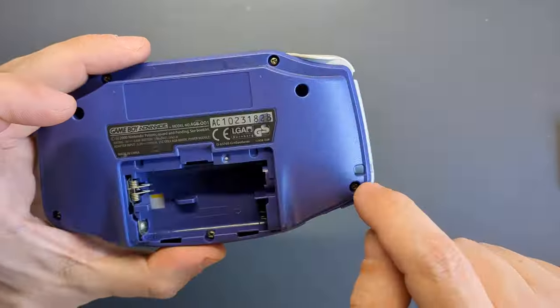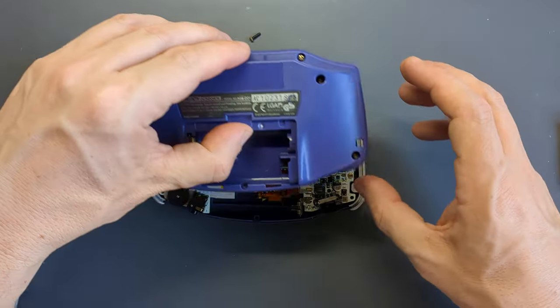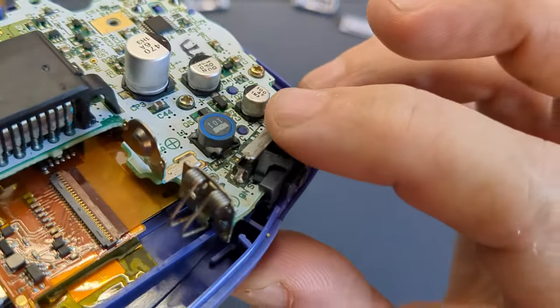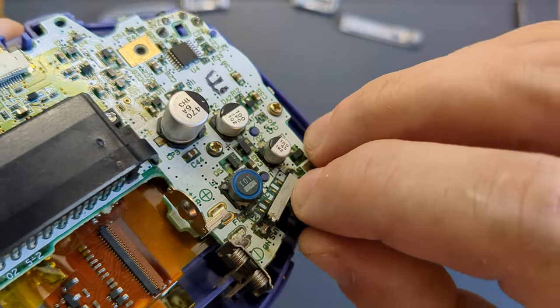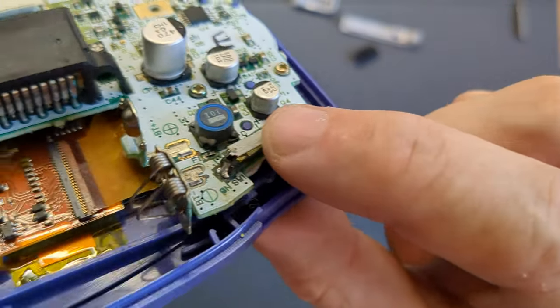To open the console, there are six tri-wing screws on the back and one Phillips head screw in the battery compartment, all of which will need removing. After this, you can remove the back shell and take out the side bumpers and the shoulder buttons. At this point, I could see clearly that the metal casing over the top of the old switch had broken. I'd repaired it a while back with a bunch of solder but it hadn't withstood the continuous motion of flicking the switch on and off, and it had come away again with all the main parts falling out of the component itself.